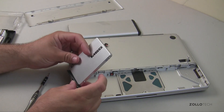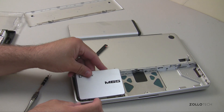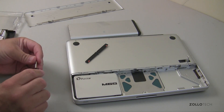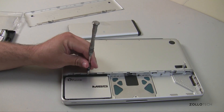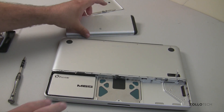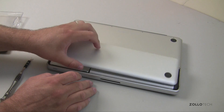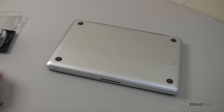Now that all the screws are in place for the mount, take the SATA cable and gently connect it — it's in place. Put the drive bracket back in place. Solid-state drives are very light, so expect it to be a little lighter. It's in — nice and snug. Place the cover back down on top; it's a little thinner than before. Then place the battery back in. If you don't have this style MacBook, just screw everything back down and you're good to boot it up.